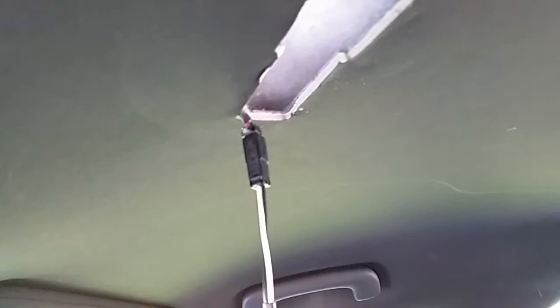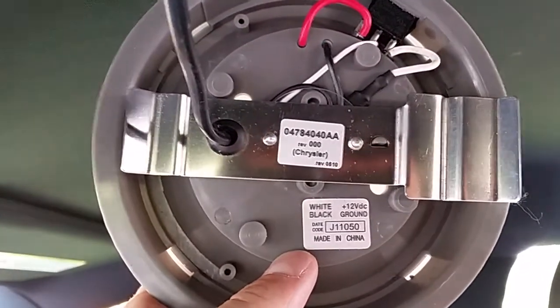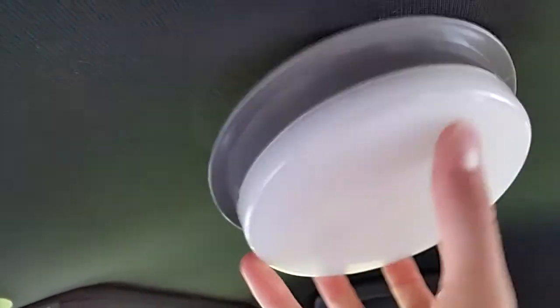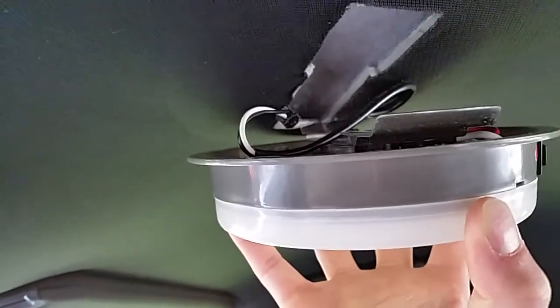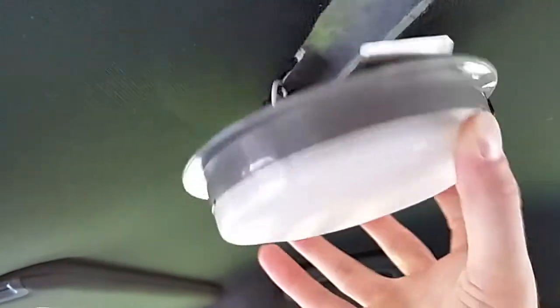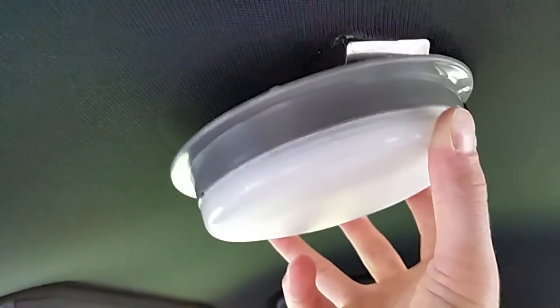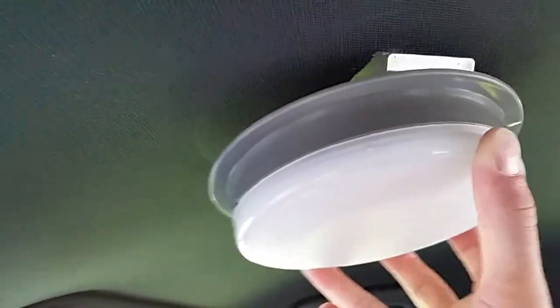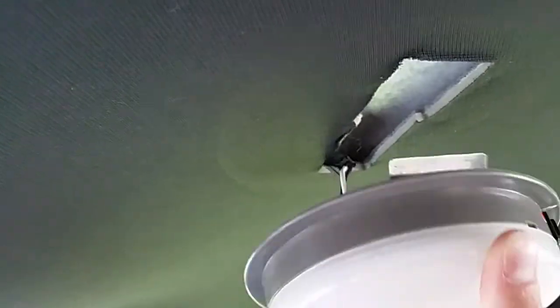Anyway, that's the proper way to remove this light. I'll give you a part number here in case any of you are looking for it. To put it back in, basically reverse the operation: first put in the larger side and slide it back — you'll see that moves it into a position where the forward clip can be placed — then go forward slightly so both clips are rested just outside the lip. Tuck the wire in, go back, then slightly forward, and it locks in. Don't pull it or try to twist it — the proper way is back, pull down, and forward to remove; back, push up, and slightly forward to reinstall.